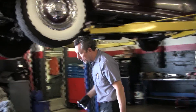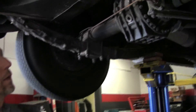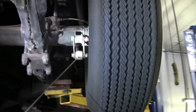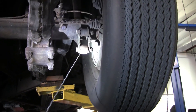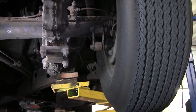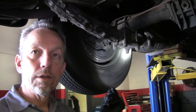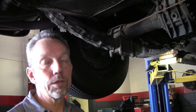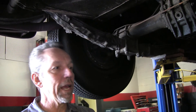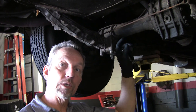We'll start at the back end because there's fewer places to leak. Normally on an older car you will see fluid here at the bottom end of the shock, because it will run down. Both of his are dry, so that means one of two things: either they're sealed and don't leak, or there's no fluid in them. On annual maintenance I have a long checklist, and part of that is checking the fluid levels in the shocks.